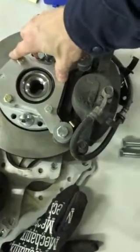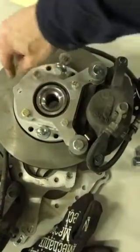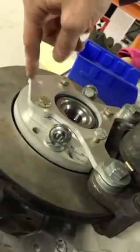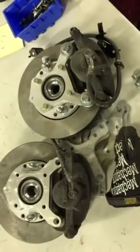So this is now a viable solution. These spherical rod end bearings attach to the upper and lower A-arms, and this spherical rod end bearing is the right offset, I think — we'll check it — so if the bearing's here, to connect to the tie rod and provide correct Ackerman for front steering rack mount.